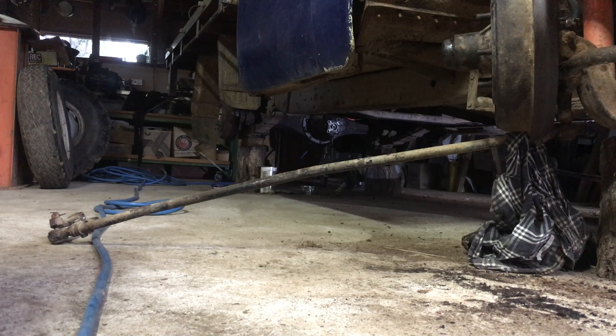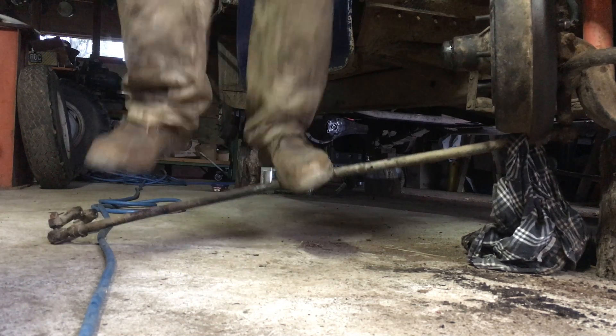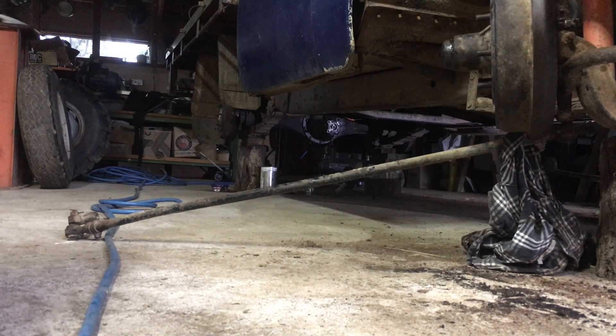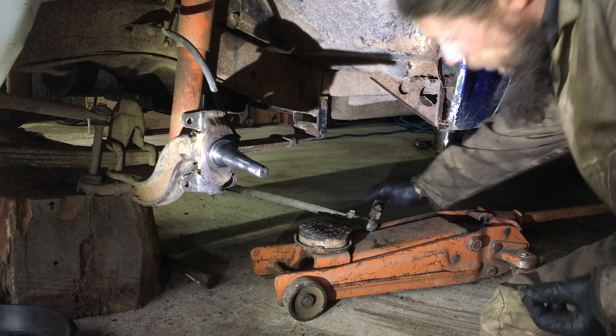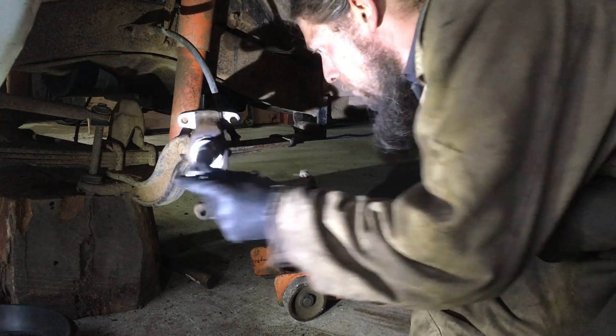This is the tie rod — it links the two front wheels together so that the steering that moves one wheel also moves the other one. I mentioned it was bent from running into something up at the farm. So I'm going to do something a little disgusting, a little agricultural — I'm going to straighten it. Near enough's good enough? That's a bit better. Just a farm ute — what's a little extra toe in or toe out? We can adjust the ends, but apologies to those Toyota fans that found that a bit brutal — me just bending the tie rod back by jumping on it.